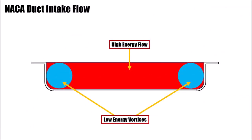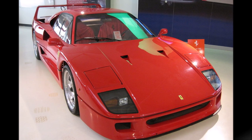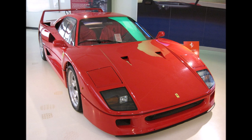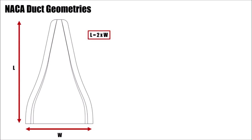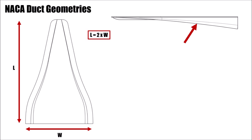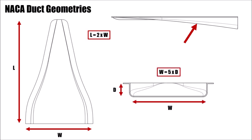The typical NACA intake cross-section shows vortices at the sides and clean high-velocity flow in the center. This is the basic principle and there are some geometrical values to play with. First of all, the length should be long enough to form vortices, and the sidewall angle shouldn't be too aggressive to avoid separations and to get clean vortices. Best practice is an intake that is around 2-3 times longer than the intake width. If the suction side is too steep, you risk separations. If it's not steep enough, you won't be able to suck the complete vortices inside and they will spill out, which would increase drag. Best practice is to have a width-to-depth ratio of around 5 — so if the intake is 100 mm wide, it should have around 20 mm depth.